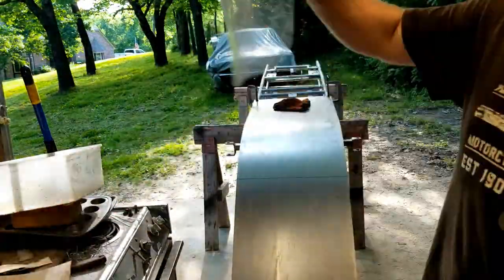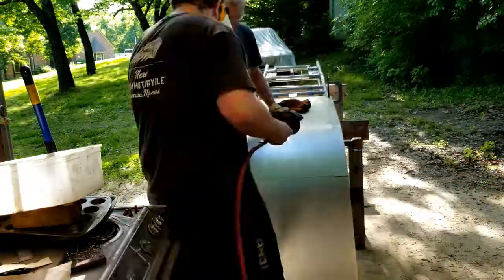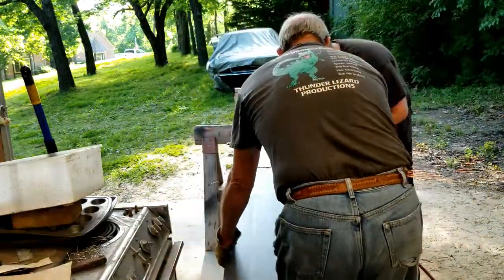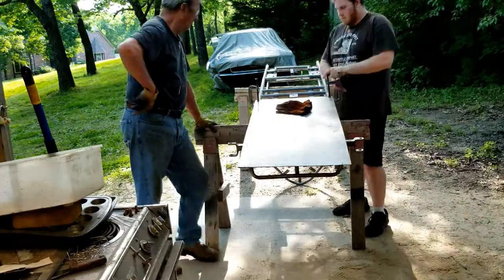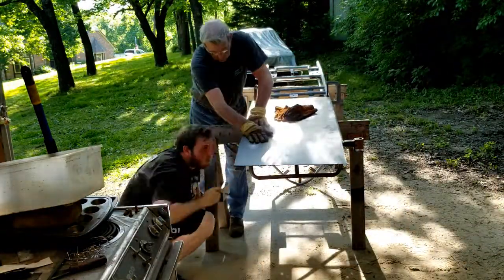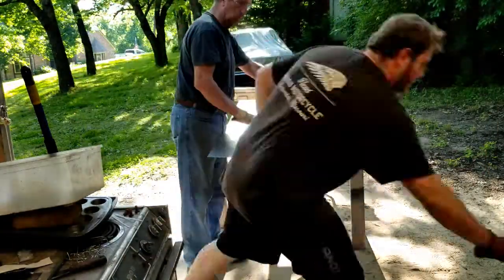The last thing we had to do before slapping a coat of paint on the KawaBunga was to install a floor. We picked up some 18-gauge sheet metal from Metal by the Foot when we first started the project. We flipped the go-kart frame upside down and laid the sheet metal across the bottom to get our measurements. Once we decided on the length, Austin sliced off the extra material with a cutting disc.